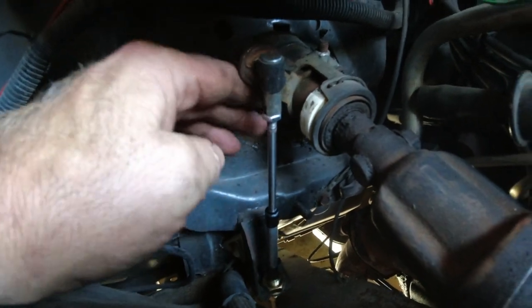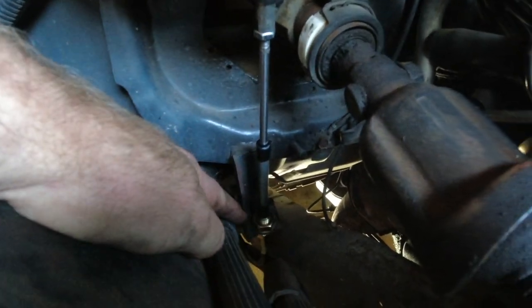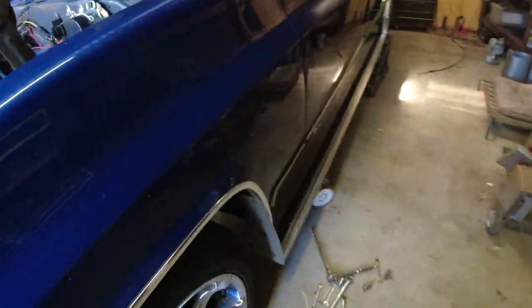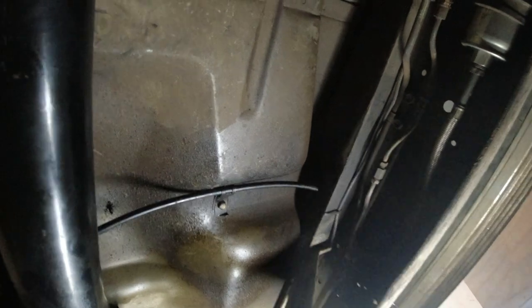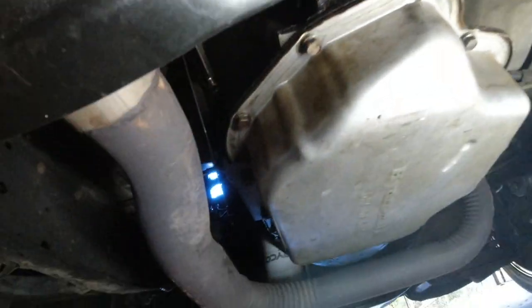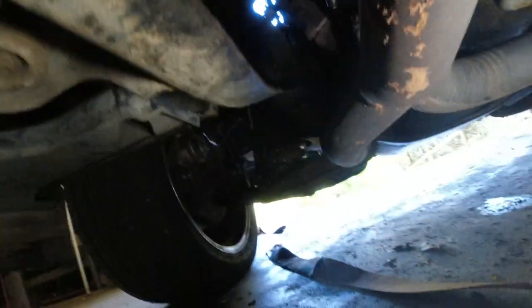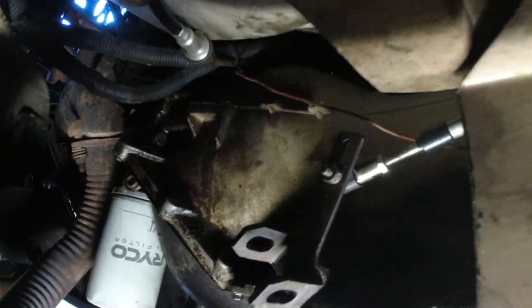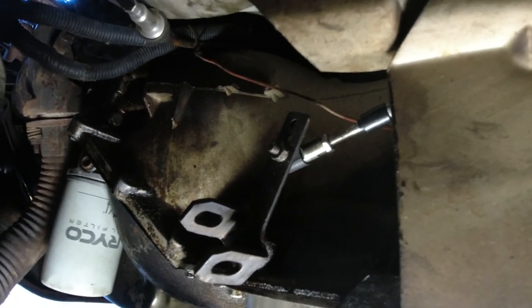So we've got the top of the cable attached up here, locked up down the bottom here on the bracket, and underneath the cable just comes up here, hooks up onto that little bracket there, sits around the back of the transmission. There are three holes on the top of the shift linkage — just go to the bottom one and that gives us a nice shift movement.